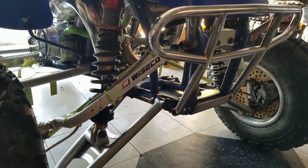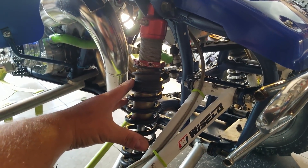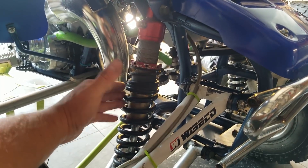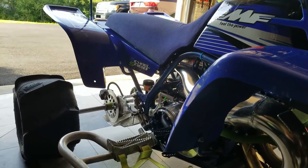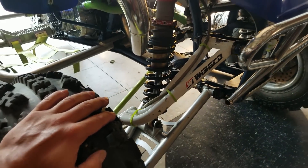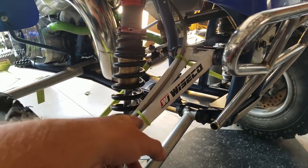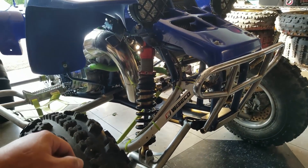Some other mods I'd like to do: I noticed the suspension was just not holding up to the dunes. These are Elka Stage 1s that came with the Banshee — it's a 1990, and God only knows when these shocks were added. I didn't have them rebuilt or valved to my weight. I'd like to at least upgrade to Elka Legacies, which is their Stage 3. It also has an OEM rear shock, and Blake from DBC Racing rode this quad and said he'd put his money on it that the rear shock is blown. Fireball Racing does make long travel J-arms, so I could sell these standard travel plus-twos, get long travel suspension, and see a dramatic improvement in handling and stability.